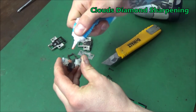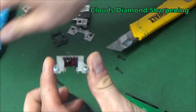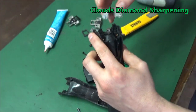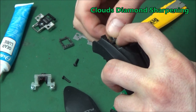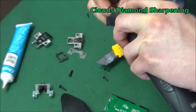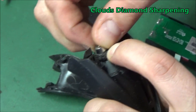So this drive will need to be replaced - I can see the wear on the edges here. You want it like this so it catches the hair instead of going into the bearing, which makes the bearing cause friction and get hot. Maybe this bearing is not fixable - we'll find out when I try to break it free. And it is moving with the hair, so you can see it moving now. We'll try.